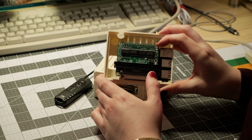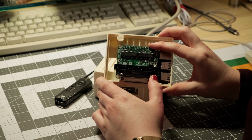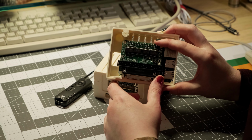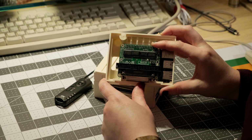But yeah, with a faster Raspberry Pi, you're going to get faster I/O speeds when it comes to writing to the disk and doing just general SCSI I/O. So reading, writing to the disk, reading, writing to your Ethernet device will be faster with the faster Raspberry Pi.